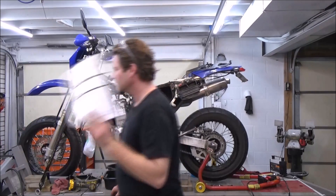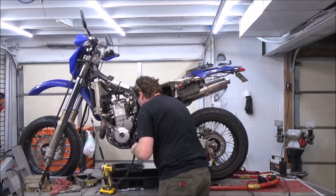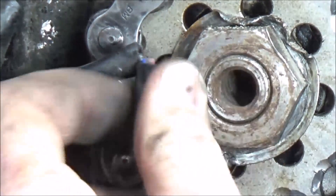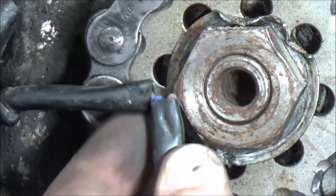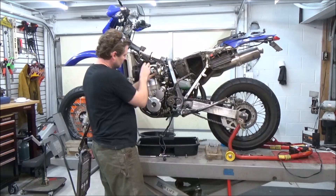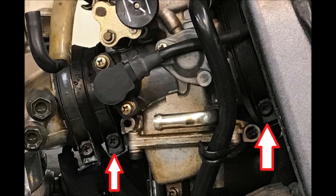Taking off the shift lever, I found a problem — make sure and record that on the work order. Anytime you find something, inspect the wires. You'll see I found some damaged ones. Record it now so you can create a checklist step item to make sure and get that repair done.